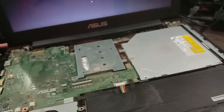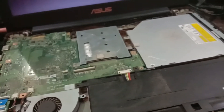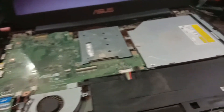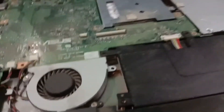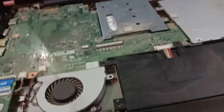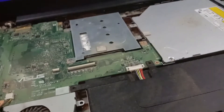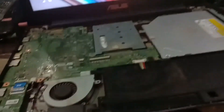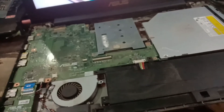So if you encounter this issue on the ASUS X453 M — where there is no power even though the power supply is working, and pressing the power switch shows no light indicator — the first troubleshooting step is to remove the battery and plug in the power supply to check if it works. As you can see, it is working now, and I will assemble it back. That is how to fix this laptop, the ASUS X453 M.